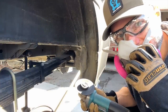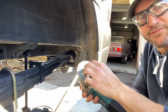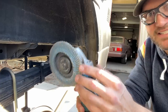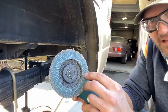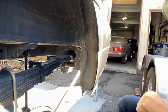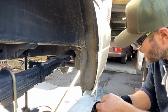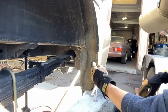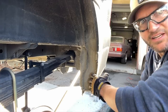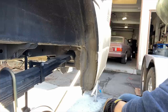So what I'm going to do is clean this up a little bit. I'm going to take the cutoff wheel off and put a flap disc on and just clean up the metal, some of the sharp parts. If you haven't used a flap disc before, these are pretty cool. They're not a grinder — they're actually pieces of sandpaper arranged in a stacked scenario, so as they wear off, they get down to a fresh sheet of sandpaper. We use them almost constantly cleaning up our racks before they go to powder coat. I'm doing this to clean up that edge because cutoff discs can't cut curves very well. There are tons of sharp things here, and then once we get that cleaned up, we've got to deal with the pinch weld in here. Once everything's done and cut, we're going to spray paint it so we don't get any raw steel out there that can start to corrode.